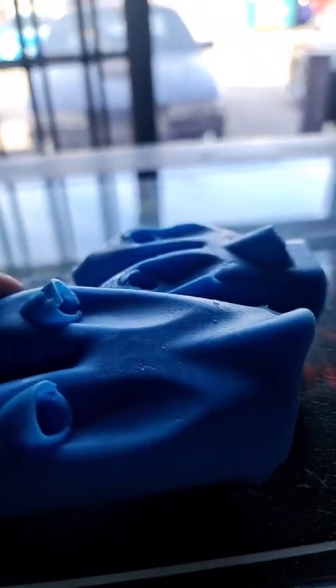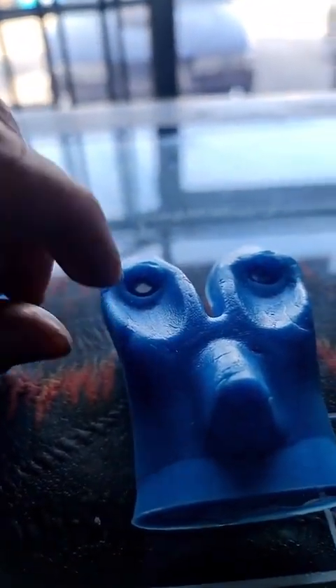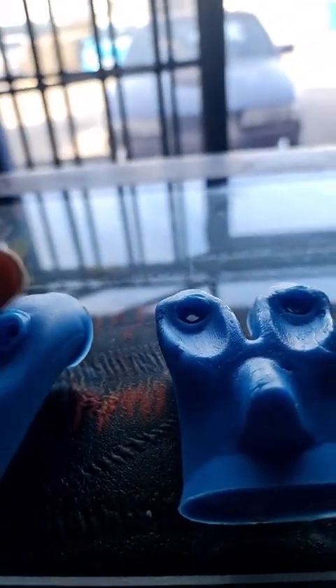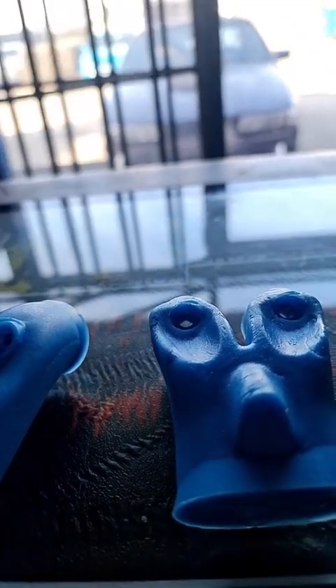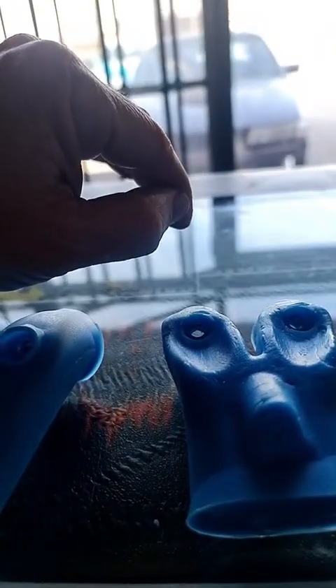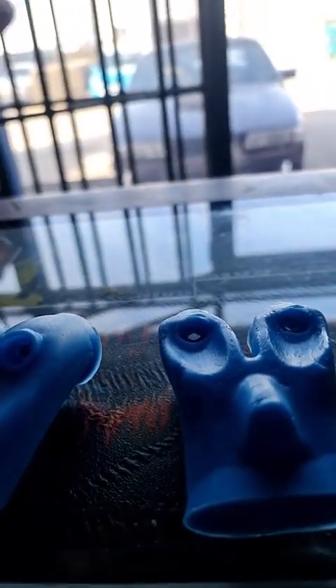With the Honda you can see we've got obviously better transitions for the guides, and bigger radiuses here because these ones are very very thin - this will create a hell of a lot of surface drag. Remember I talked about big corner radiuses? That's because you have two converging boundary layers coming onto each other. Here we've wrapped two boundary layers around the air, so the air trying to flow through them will have a hell of a lot of drag placed on it by the walls - hence why we're going to open these channels up once we start porting this.